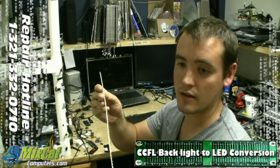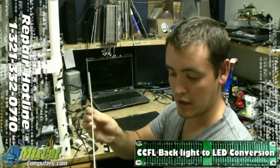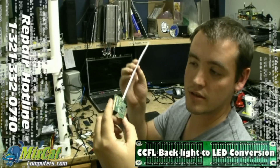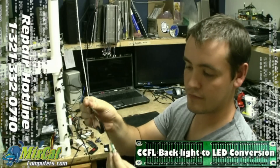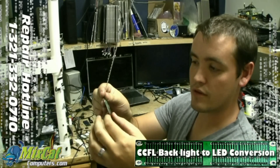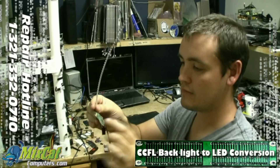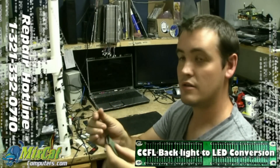There's a 17-inch LED screen that was broken because we brought in the laptop and needed a new screen installed. We put a new screen in and pulled these components from it. Now, this is part of the board — this is actually the stepper circuit. What this does is it takes the 19 volts from your laptop, from the input from the inverter, and we're going to run that with enable light, dimmer switch, and ground. Four wires, that's all it takes. This will step it up from 19 volts to 27 volts in order to power the light.